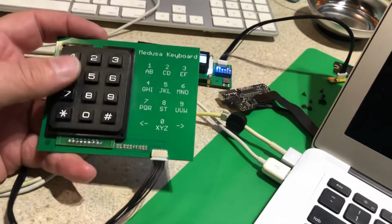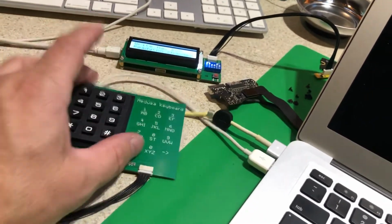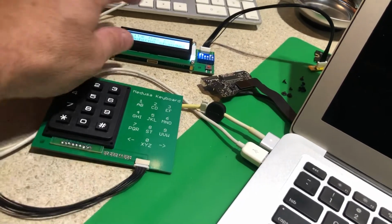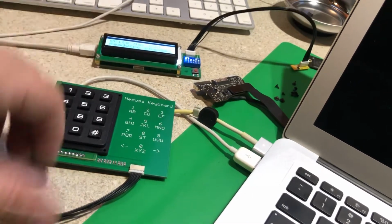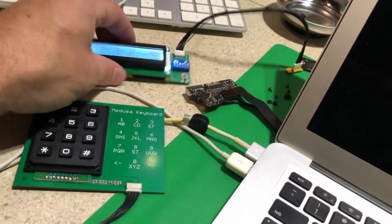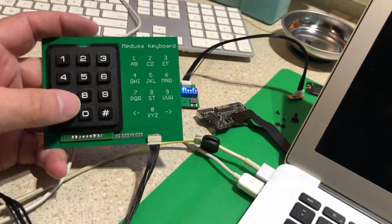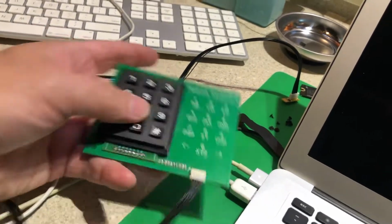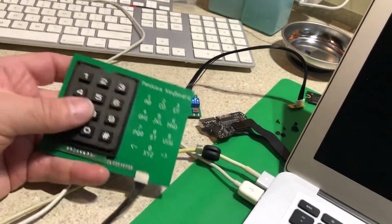What's nice about this is if you've got a board and you don't have the original board and you want it to match the bottom case, you go ahead and change the storage serial number that's in this box first by plugging this gadget in, and then you hook it back up to your board and write it. So this is a big time savings. Even though I complain about the functionality of the switches and the keyboard, you don't have to use a computer. This is autonomous.